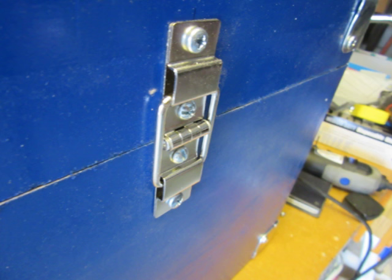The 2 inner screws right by the pivot point of the hinge are actually bolts, not screws. They're machine screws, and because these are so close to the valances, what you actually want to do is drill and tap the valances for the size of screw you bought, and then the screws are basically being anchored in the aluminum valances instead of in the wood. This is stronger and just works out better, but in my case, I was unable to buy both types of screw with identical heads, so they look a little different here.